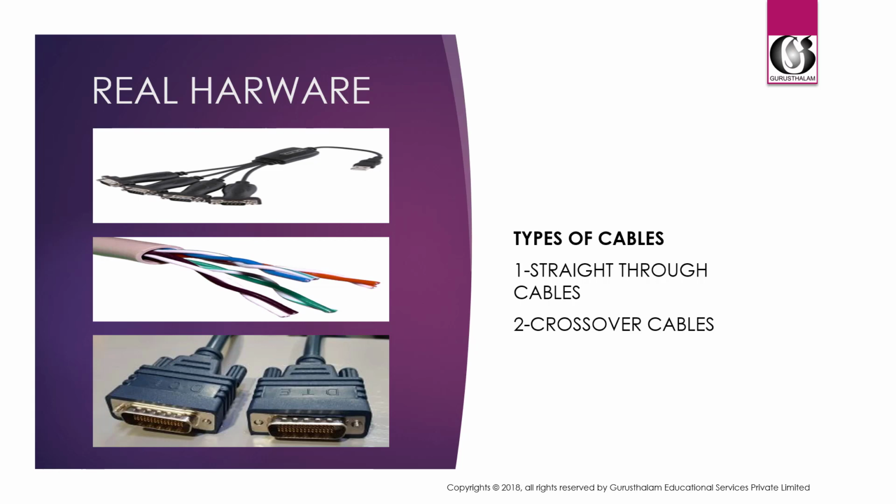Apart from that, there are some WAN protocols that you will have to practice. These require serial interfaces and serial cables. It depends on your router model which interface and cables you will need. The picture below is a DB60 serial cable that can be used with a WIC-1T serial interface. I recommend getting two serial cables for your lab.